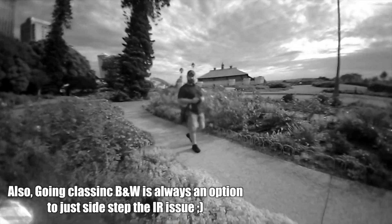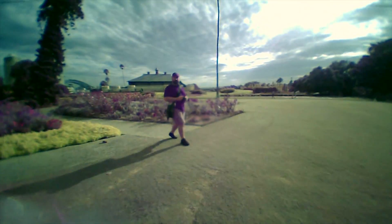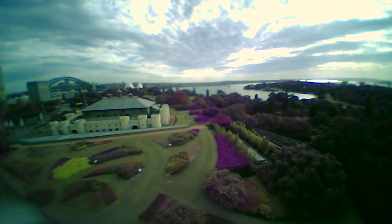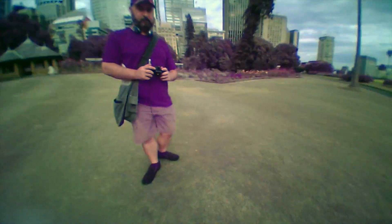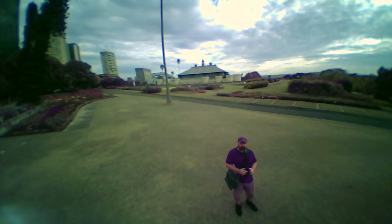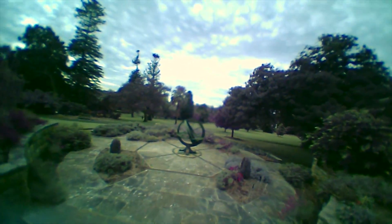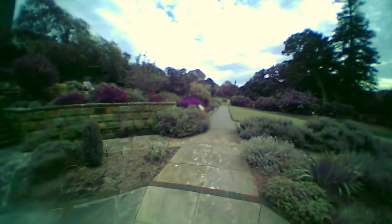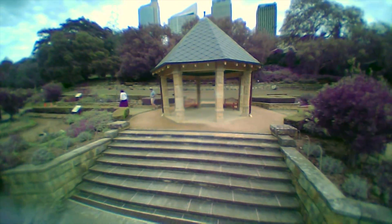The other issue I hit with this new lens is lens distortion. Ultra-wide-angle lenses have lots of barrel distortion just thanks to the physics of what they do. Some much fancier lenses optically correct for this to some extent, and many digital cameras will correct for the distortion internally. But this camera has its brains set to correct for the longer lens it's supposed to have, so it's automatically applying those corrections for what it's seeing through this lens, and that makes things look a bit goofy. In addition to the barrel distortion natural to the lens, the now-incorrect lens corrections make other parts of the image bow the other way, giving quite a kooky effect. That slight blurriness in the bottom left corner is the edge of some box tape I used to temporarily hold the lens in focused position until I was sure it was properly focused before fixing it more securely — and as you can see, I'm not quite perfectly in focus, so good thing I taped it before gluing it.